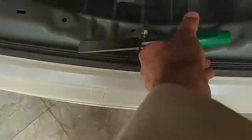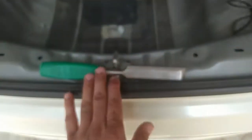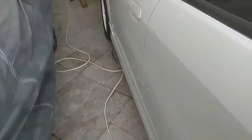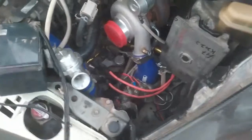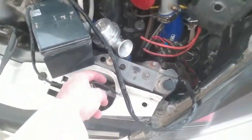And since this has a charcoal coating, the welding will not work here. So if I need to weld a metal piece here, I will just remove that charcoal coating. Right now I placed it there so that my boot should not be closed, because the battery is out, because we are about to do the welding, so the battery should be out. This is just to open the boot. This is disconnected.